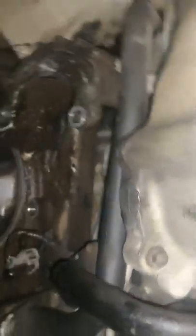Don't get too crazy when you've got oil and coolant mixtures. It doesn't necessarily mean you've got blown head gaskets or anything like that. It's a possibility, but you've got to ask the history on the truck. You've got to know the owners — what are they using the truck for? He just said he was driving and not pulling anything. Had an empty truck. This is a 550. He works on a chipper in the back. So I know the truck was never overheated.